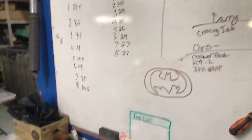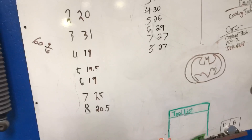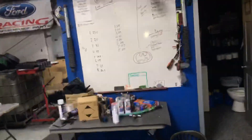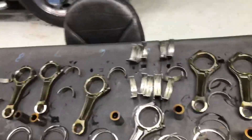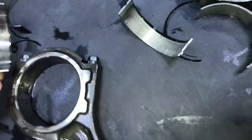We'll give a second for the internet ninjas to tell us what they think that means. On bent rods — I say stretched, whatever, wrong word — bent rods could cause that. We're going to have to run these through and see. We had four thousandths in play on the cam, and we had eight thousandths on the crank, which is — but some of it the crank definitely needs polished. There are a couple spots where it hit pretty hard on the bearings, but that's what bearings are for — they're sacrificial.